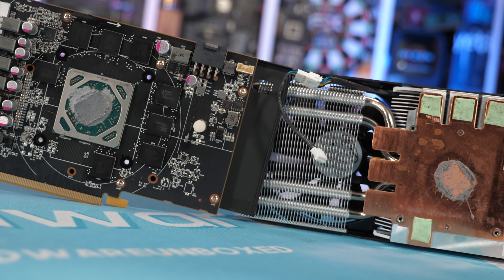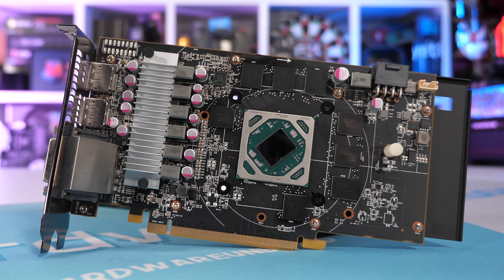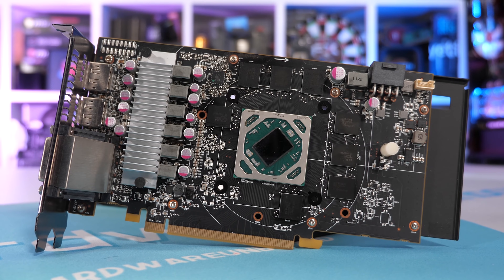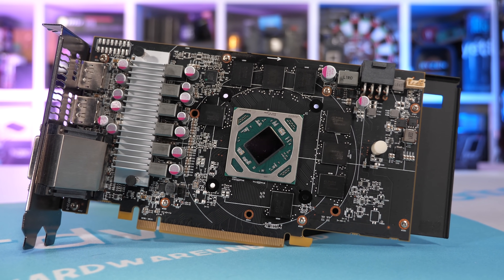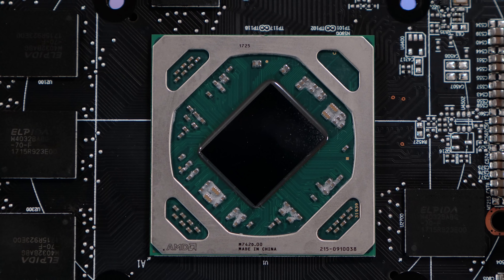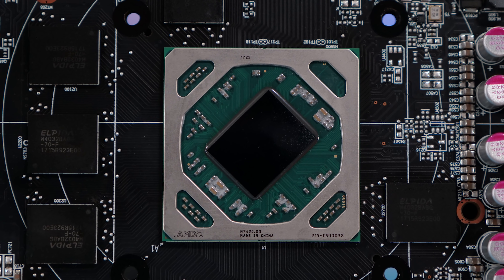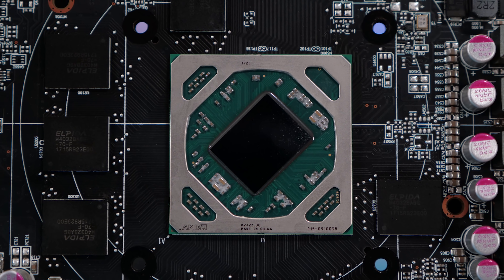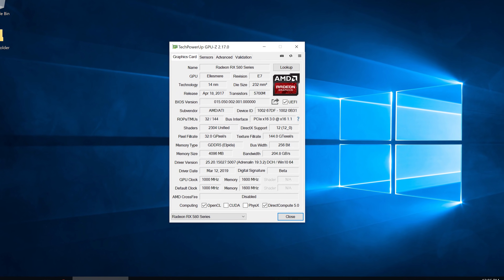The guys at Silverknight PCs checked the other models and found they were also missing some thermal pads. The PCB design and componentry also looks pretty legit, and the GPU does appear to be an RX 580. It also looks like a fairly decent 5+1 phase VRM. So everything here checks out. Throwing it in the test system, it's definitely looking like an RX 580 — an underclocked RX 580, but an RX 580 all the same.